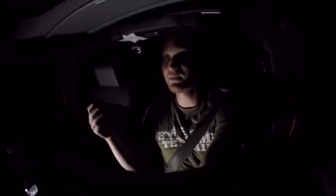Now I'm gonna kick the gutter lights off and turn the rock lights on. I'm actually very surprised by how much light these throw from inside the cab. It does a nice job of lighting up to my left and right, even further around the corner than the light pods up on the A-pillar. But rock lights in general are gonna be more for your spotter helping you out than for you as the driver. I can lean out the window a little bit and they do help me see, but mainly this is so my spotter in front of me can see what I'm about to run over so I don't get hung up on anything.